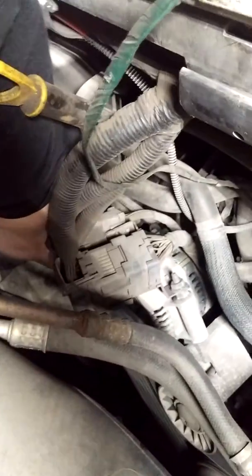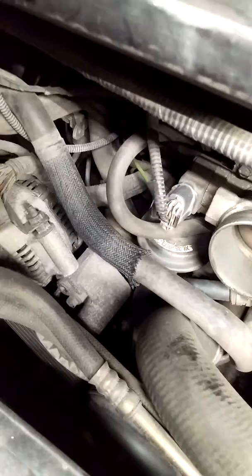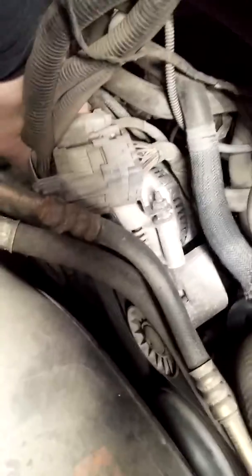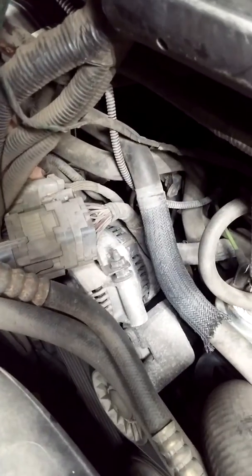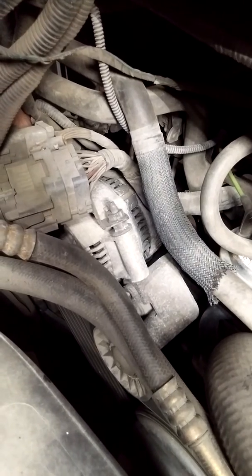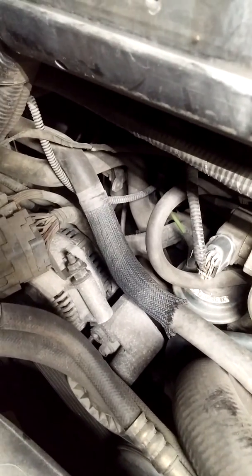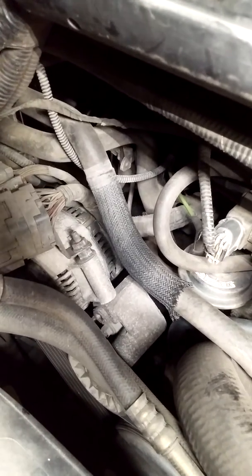But for those of you who wonder what this looks like getting it from the front, you've got to come in behind your alternator down here, and these wiring harnesses and all this stuff, and you can feel where the spark plug is, and that's where my arm is right now. And that actual ratchet will work all the way around it, so that I can get this from several different positions. Just your preference, whichever way makes your job easier. But the front plugs are usually the ones that require you to get a little bit creative on some models.